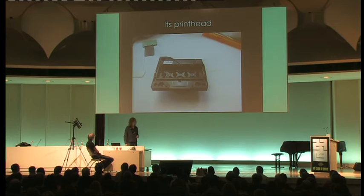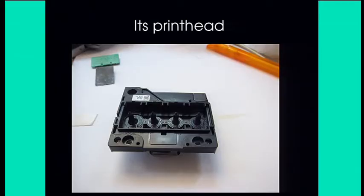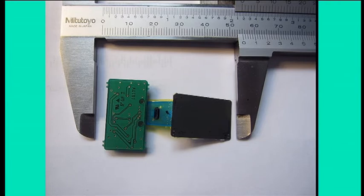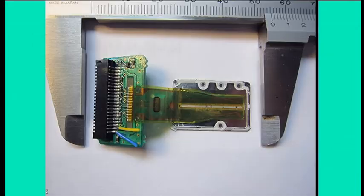If you strip apart all the bits of printer you're not interested in, you get to the printhead. There are four needles that plug into the four cartridges — cyan, magenta, yellow, and black — and on the bottom is the nozzle plate: the assembly of microfluidics and piezoelectric wizardry that actually does the printing. On the nozzle plate you can see two rows of nozzles that are barely visible. On this flexible circuit board the little black blob is the control chip — that's what we're interested in talking to. Flipped over, you can see four ports allowing ink into the printhead, and a connector PCB on the left which is purely a connector with no electronics — all the electronics of interest are in that black blob.